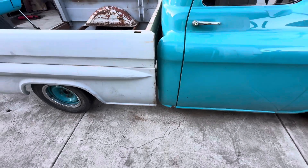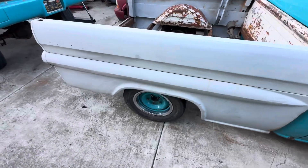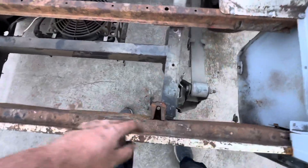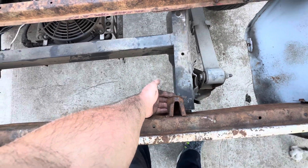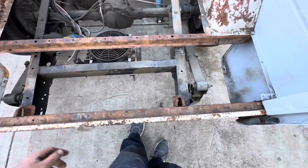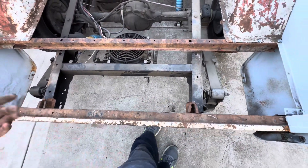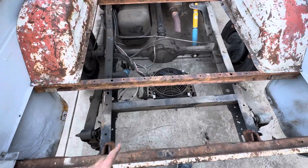It's lining up to the truck cab pretty good. The main problem is this gap right here. I had to cut and notch the frame a little bit. I'm going to put a bracket plate and weld it there so I can bolt to it — I might even just take a piece of angle iron, put it across there, easy bolt together.